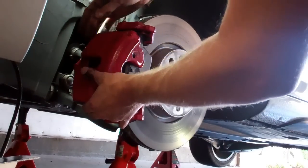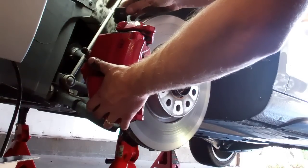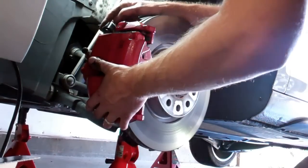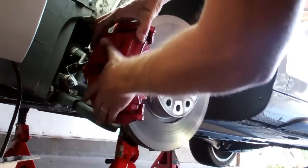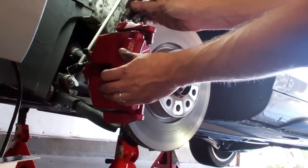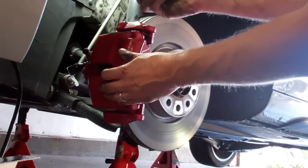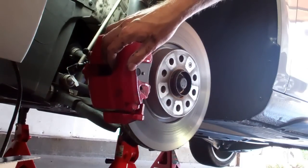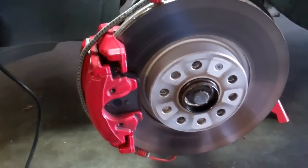So once you have your pad snapped into the caliper side, you gently lay it down here. Keep a close eye on your wire — make sure that it's nice and clean and not stuck anywhere. Then that'll snap in right here where the connector is afterwards. So once you feel like your caliper's in there all the way, I'm going to then do the two sliders. I'm going to clean these up first — there's a lot of gunk and dirt and you want to make sure these are smooth. So I'm going to go ahead and polish these up before I put them back in. You can also use the bungee here to keep your caliper nice and tight in place as you do your bolts.